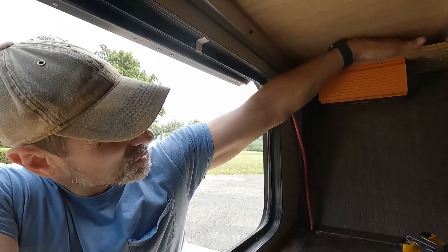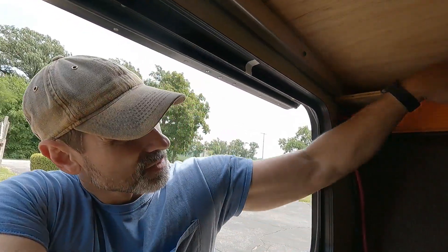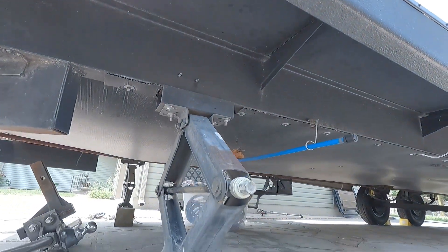As you can see I got the inverter mounted here. I drilled holes in the back of it to make sure there's plenty of airflow as much as possible so that it keeps the heat out of it — you've got to keep these things cool. It has a fan system in it, the fans are on this end and it has room to move there, but I just wanted as much heat dissipation as I could get. I've decided that I'm just going to have an extension cord run from here all the way back to a plug in the back. There's going to be a dedicated plug that I'll be able to plug into and it will run off of this and power my distribution box. Since I have this access door right here which is kind of like a closed hamper, I can easily run an extension cord through there. Instead of trying to run a wire all the way to the back, this is a simple fix. It'll be easy for me to just wind that cord up when we're stopped for the night. I'm going to verify this inverter works and then make up my cords and then we should be good to go.